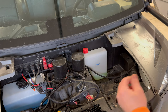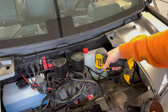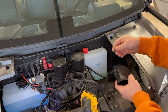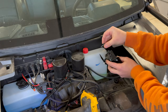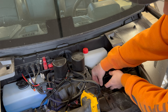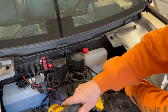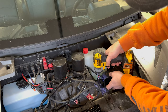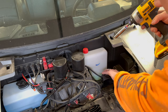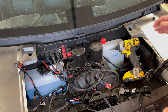We're going to go ahead and put the horn on. It's going to be a 10 millimeter — you're going to use a factory screw or bolt here. Get that out, take your horn, it's going to go straight back down in there. There's a little hole here — get it started by hand first so you're not stripping anything. Snug it down so it's even right there. Perfect. Let's go ahead and start putting the harness in here.